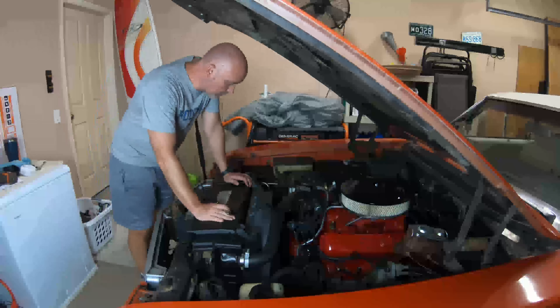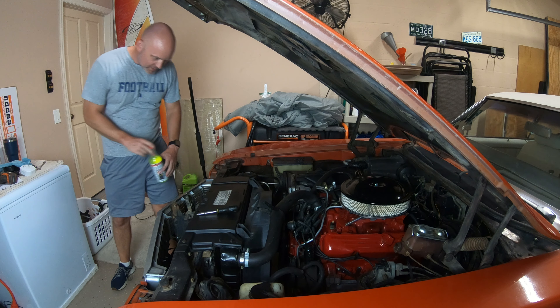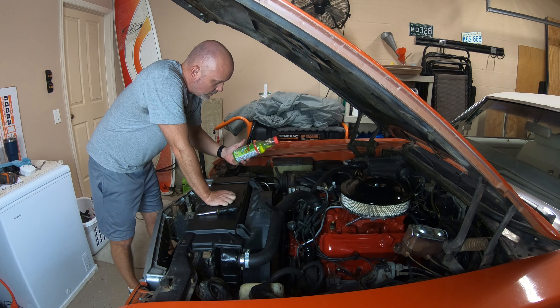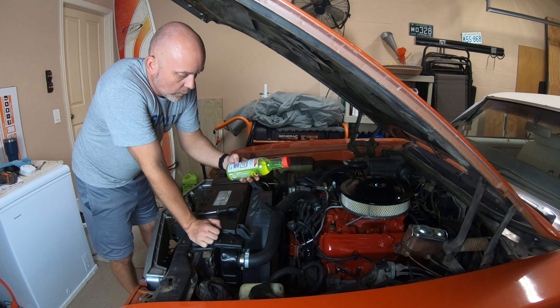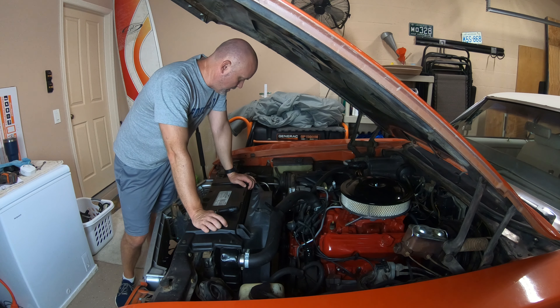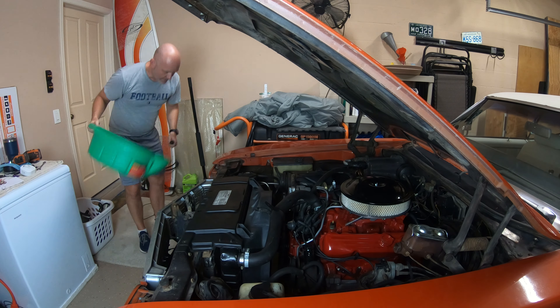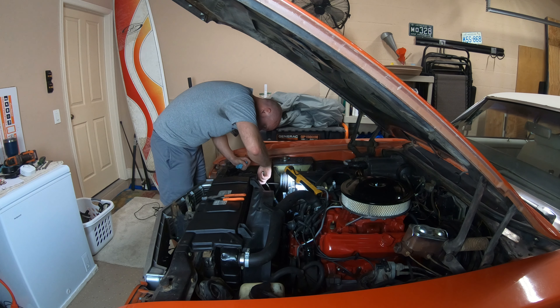Simple enough — we'll just start by dumping out this radiator and uninstalling it. It has just pure water in it right now, so we'll need to flush it. I'll fill it back up with distilled water at first, run it, and see how the temps work. After that I'm going to try this Rislone Super Coolant — it's supposed to cool it down even further. The claims are 219 degrees with water only, and if you add the super coolant, 189 degrees at the top. We'll have a little fun with that and see if it does anything. Let's get into the install.